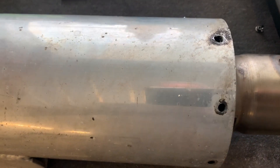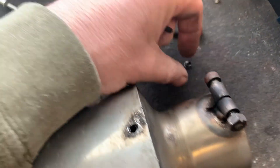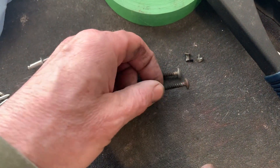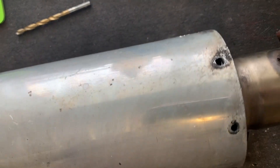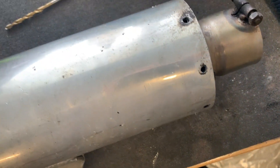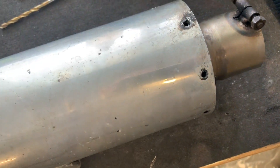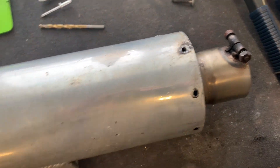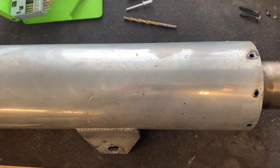We're on to the silencer repair and refinishing. There were a bunch of rivets missing, and two rivets that were really loose so I pulled them out — didn't take any effort at all. Then there were two very large self-tapping screws in there, plus a few other rivets that were missing. So we've got six rivets that need to be replaced. My plan is to put in a slightly larger rivet because the holes are so galled up. I'll clean it up, drill to the right size for the rivet, pop the new rivets in, and then move on to actually refinishing the outer skin of the muffler.